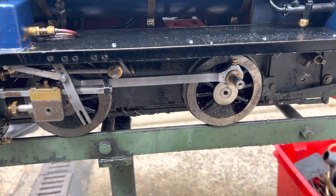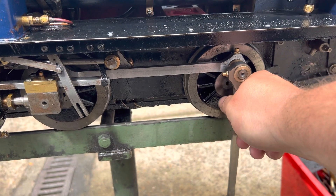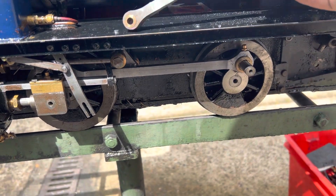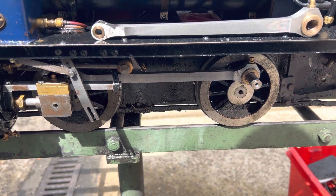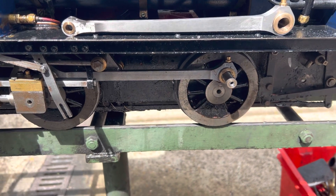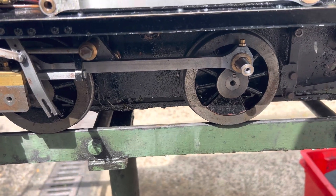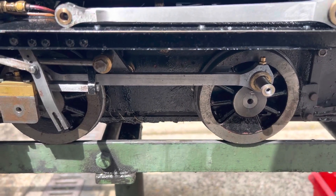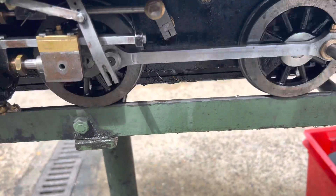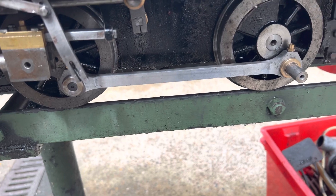We're already a step in by this point. I'm not going to say what happened — you'll see what the problem is in a minute. So we've let the rod go from the front, the little end in the crosshead. Very easy. Just undo the nut stud that moves the lubricator, half undo it, give it a tap, move the rods to the top, take it right out. Push the bolt through — it actually comes from the back — drop it down. Undo the allen bolt that goes into the rear drive pin, and slide the whole thing off.